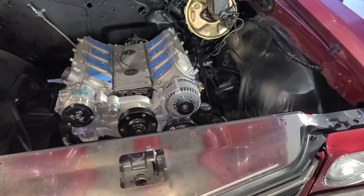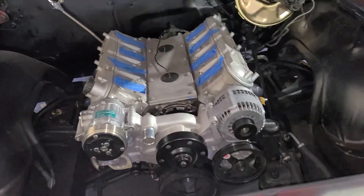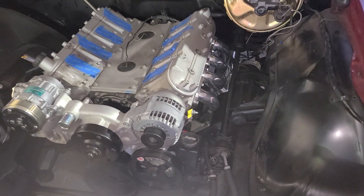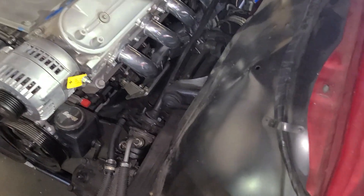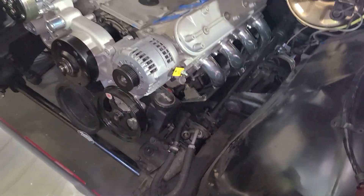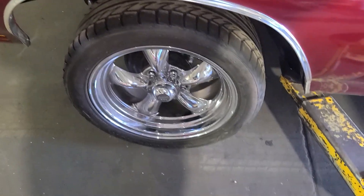So we had to pull some hocus pocus here. We had some things kind of change for us. So we did not put our 6.2 in here because we have something changing for us. So we went ahead and installed this LS — it's backed by a 4L60. You guys can comment and see what size you think it is. So we're still using all Holley components to mount everything — we got the hooker headers, the hooker mounts, and a Holley mid-mount serpentine setup. Let's raise this thing up in the air, we'll be right back.